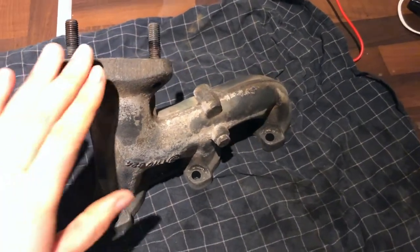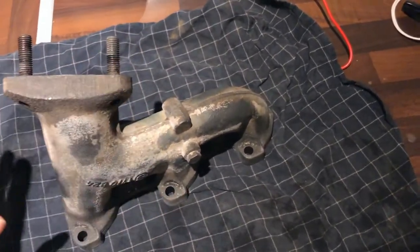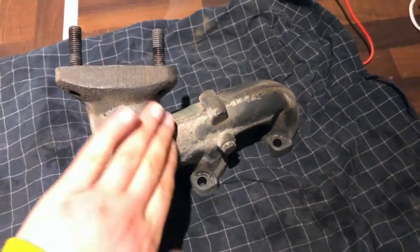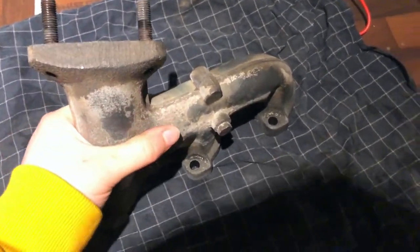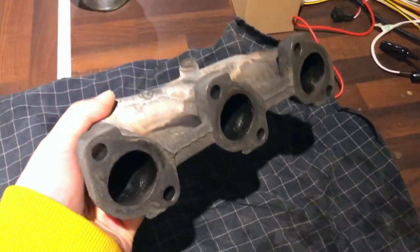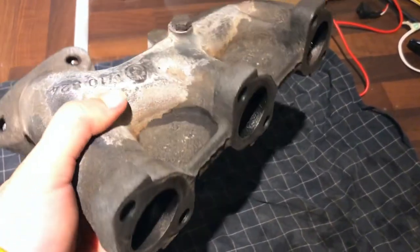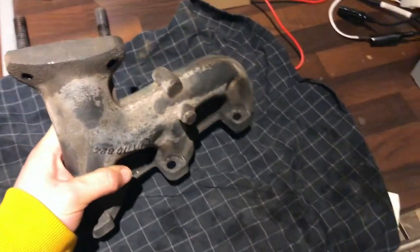We'll take it to the workshop, to the garage, and I'll mask it off. Maybe give it a quick wire wheel before, you know, to take off all the flash rust. And let's give it a quick coat of high heat paint, and this will be ready. I mean, so good, I cannot wait to put it back on the car. Let's do that now.